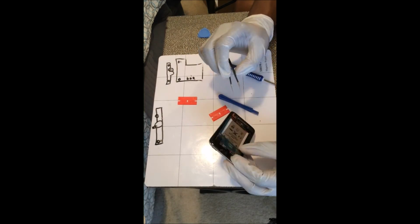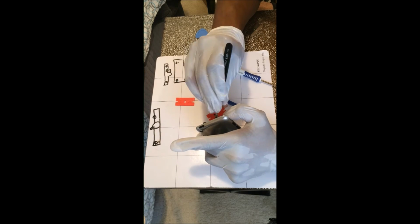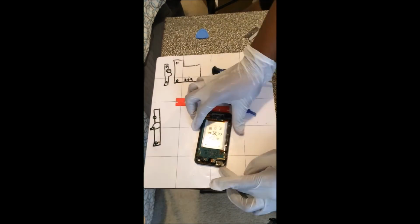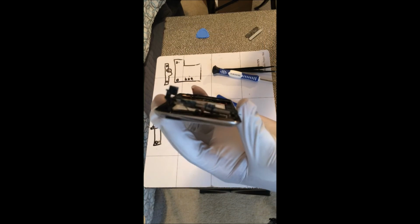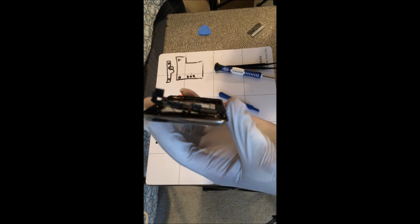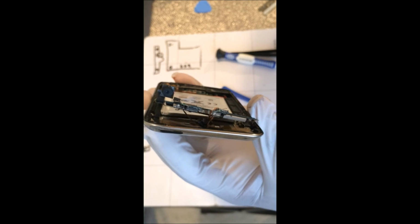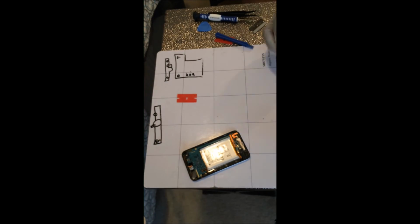Just enough for you to get to the flex cable that was connecting the original LCD, so that way you can remove that for when it's time to attach the new one. And as you can see, it's not much space, but it's directly on the other side where you attach your new LCD, and you just repeat the process of attaching everything you just removed in reverse. Check out part 2 in the description.